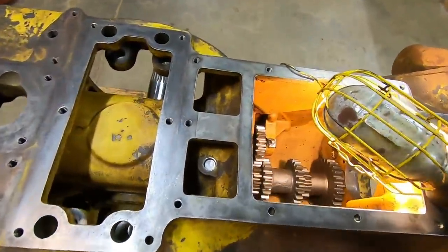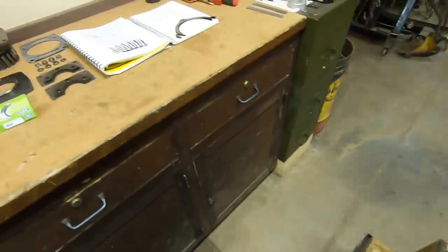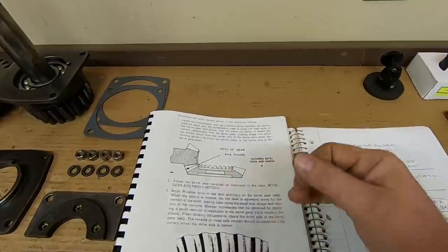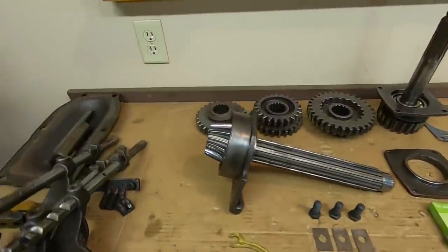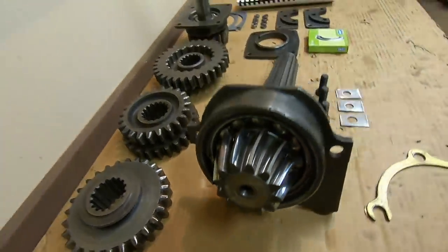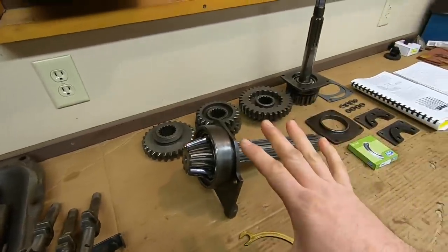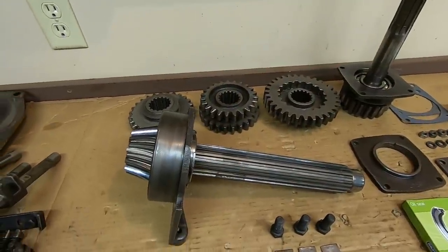Now that we know what we're looking for, how do we get there? It depends on what type of gear set you have. If we had a brand new first-gen straight cut gear set, we would knock out the line-of-sight plug, look straight down at the gears, and shim the pinion so the heel ends of both gears were in line with one another. That puts you in the neighborhood of the correct setup, then through trial and error make fine adjustments. But we have the second generation helical cut gear, and you'll notice a plus-seven scribed on the end of the pinion - that's called checking distance. It deals with the end of the pinion to the centerline of the axle and typically involves calibrated factory tooling to determine pinion depth shim selection.